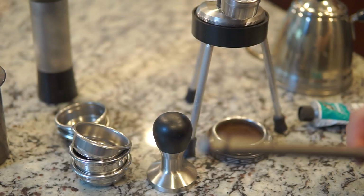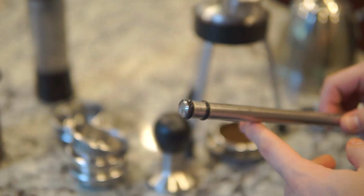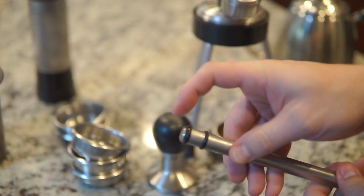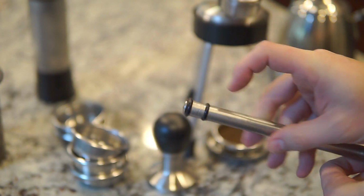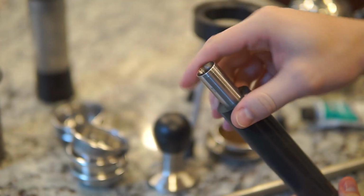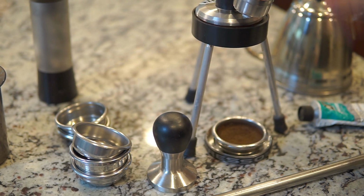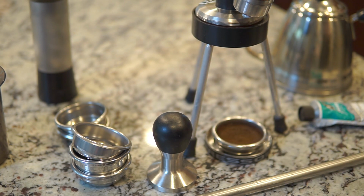You can let the seals dry out and put it on only when you have to. You can see a little bit of coffee fines get into it, so it does darken or blacken over time. What I typically do is just take my hand and redistribute that grease over them now and then wipe it on the top of the cylinder up here, and that just kind of keeps the grease all inside the system. Once it gets pretty dark and hard, you can wipe it off with a rag and then reapply.